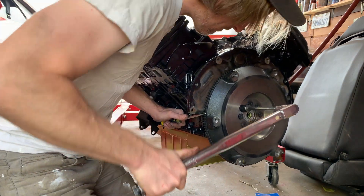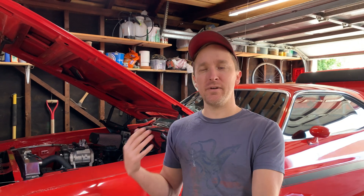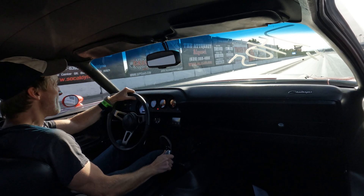If it does make the clutch more sensitive, it's not noticeable, so I'm hoping it doesn't affect this one too much either. The flywheel bolts onto the back of your engine and it spins up with the engine — it sort of cushions the engine spinning. Every time you're accelerating, the engine is actually spinning up the weight of the flywheel. If you can save some weight there you'll be able to spin the engine up faster, which gives you more acceleration. A heavy flywheel can smooth out your clutch action and makes using the clutch a little bit easier. A lot of people say a heavy flywheel stores up energy, so at the drag strip launching at four or five thousand RPM you have some energy spooled up.